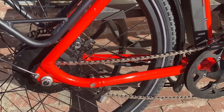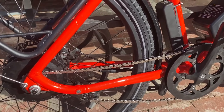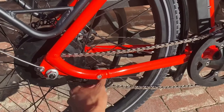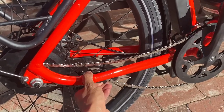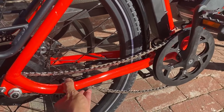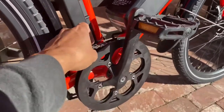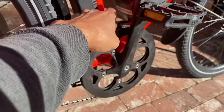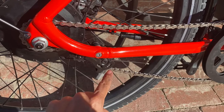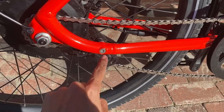When you're removing the rear tire, you're going to have to remove the chain — there's obviously no way to take the tire off without taking the chain off. The easiest way to do that is by pushing the torque tensioner forward, which gives you all this slack in the chain, making it easy to just wrap it over the sprocket. The other option is to remove the chain tensioner, which I did originally, but it's kind of a pain to get back on.